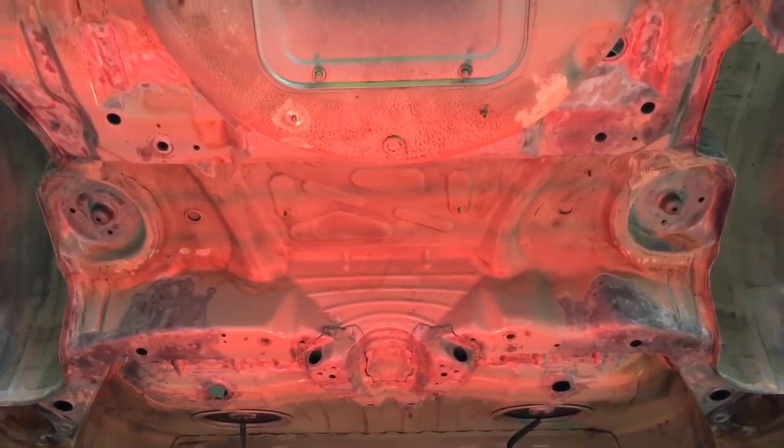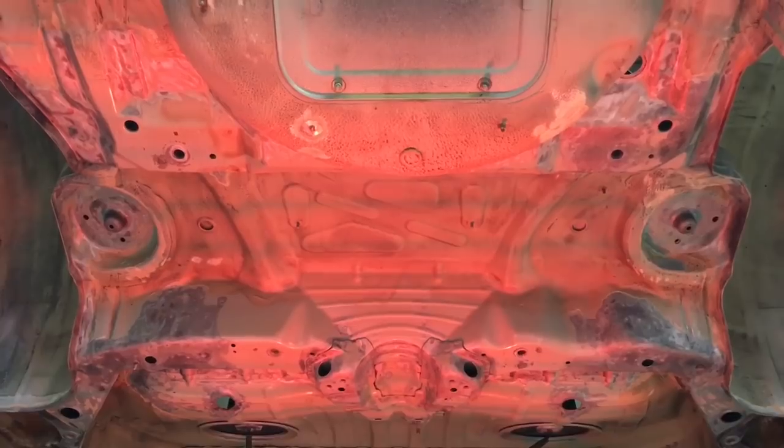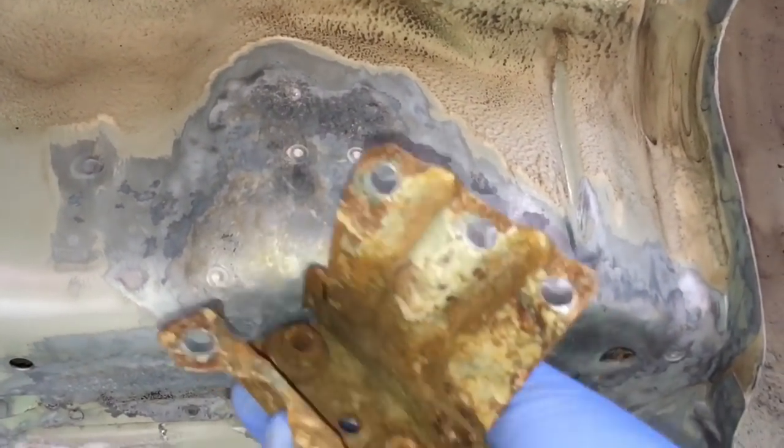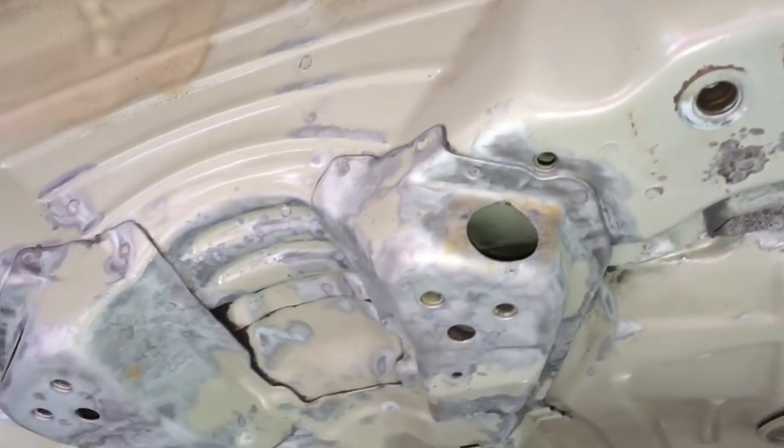The Por-15 Metal Prep has been on for 30 minutes. We've wiped that off with a warm damp microfibre cloth and now we're just drying the panel with the infrared lamps — which is why there's a red colouring. It's looking really good, very little corrosion anymore. The heavy corrosion that was around that point there — you can see it's just starting to turn a darker colour, that's neutralizing it and coating it with a zinc phosphate finish so that when we go for our etch primer process it will adhere even better than just on bare metal alone.